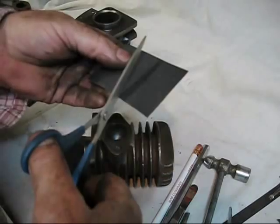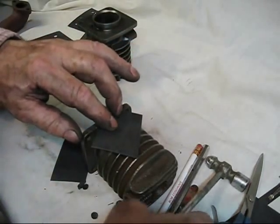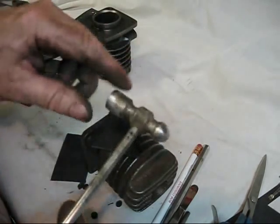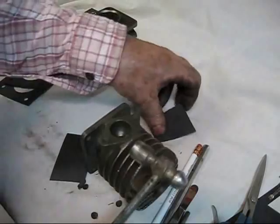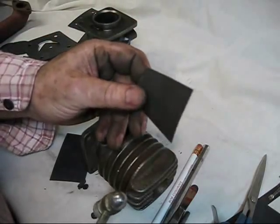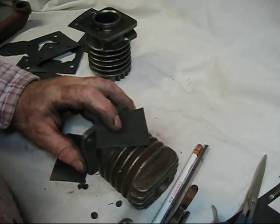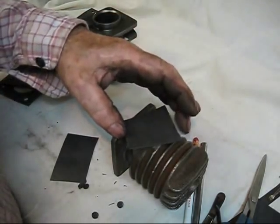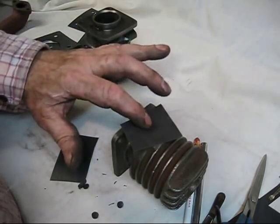The next project is I need several of these exhaust manifold gaskets. This here is the remnants of the piece of gasket I had. The way you do this is pretty much the same thing. And I know if you've had one of these ball-peen hammers for all these years and never did know what that little thing up there was for — now you do. Just get your ball-peen hammer out and get a piece of gasket material. I do advise not to be using a cornflake box; they just will not work. If you want a very tight, professional job, go buy some professional factory-made gasket material. But to make these manifold gaskets is as such.